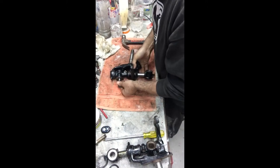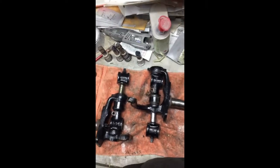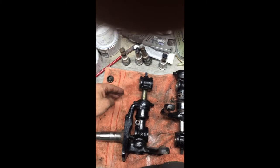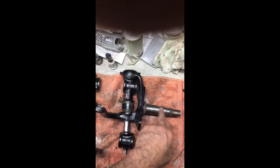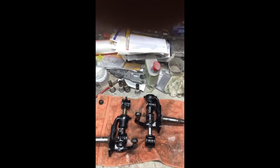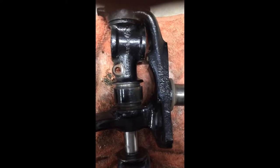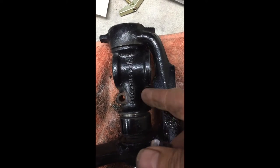Let's get that all sorted. This gives you an idea of what's going on. On the left, that would be the stock setup - disregard this bit here because that would be pressed in. You can see where your axle is and where your wheel would be. Now with the flipped spindle, you can see how much higher up this one is - about two and a half inches. Here's your clearance issues. You need to grind up the top in there and obviously down in here. Once you've put the pin in and the shims, it's going to move the pin further out, and this is where you end up with this issue.